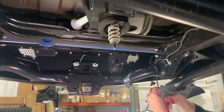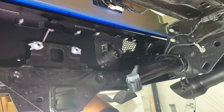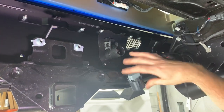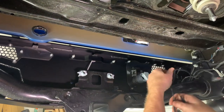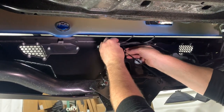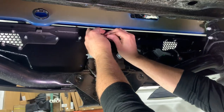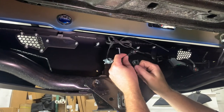Clip all the little push pins off the factory wire harness. Make sure to reach up behind your trailer plug and snap out the little retaining clips. Then plug your trailer wire harness back in. For the license plate harness, run it across and zip-tie it in using the little brackets, then clip the plug off and wire into the ORO wiring harness.